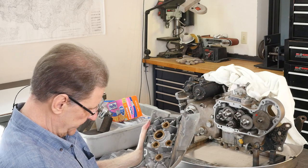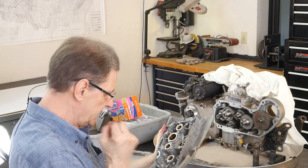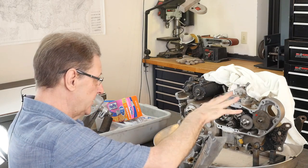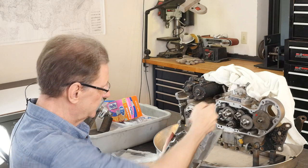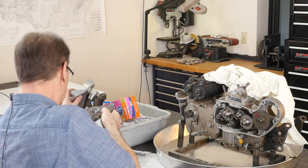These, I noticed, don't have pins like the earlier models. There's a little steel pin that keeps them from rotating. These, they must just press fit in. You have to ream them. As a matter of fact, I think you're supposed to ream them with the cases apart to line ream them. It's a big deal. Then the cams,